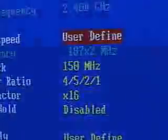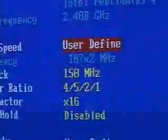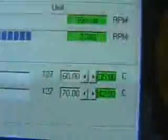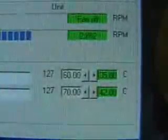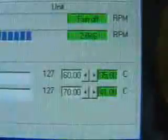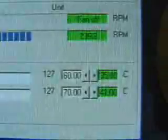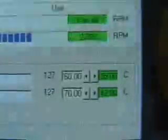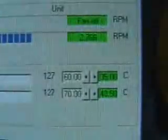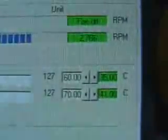Very fast. I am using the OCZ AD3000 memory, which is quite good at overclocking. With my case closed and the CPU at max load using the retail heatsink and fan, you can see the temperature is quite good at 42 degrees C. I currently have the CPU at its default voltage of 1.5V, running at 2.4 GHz, which certainly helps lower the temperatures.